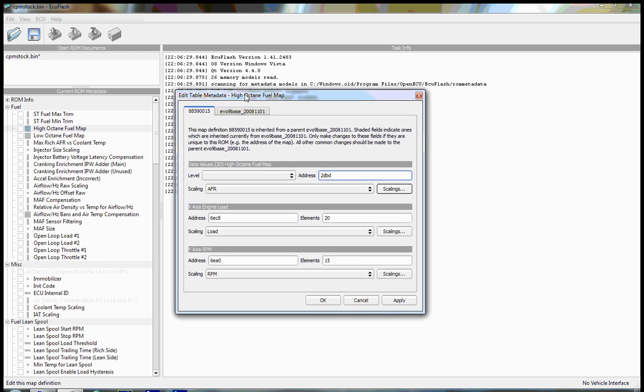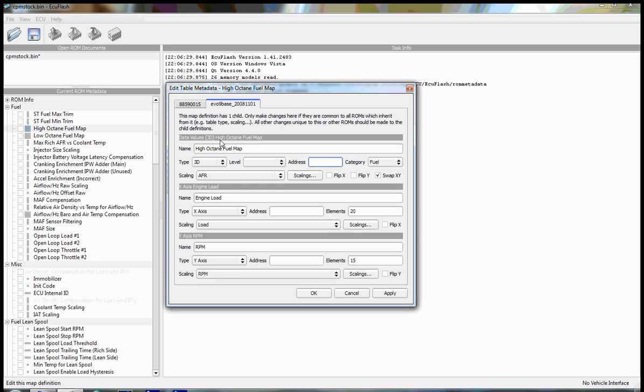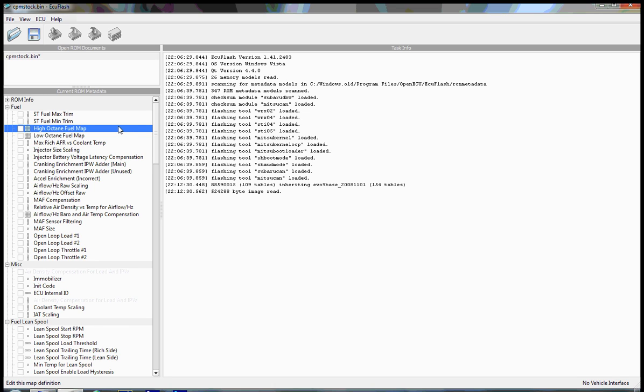So if we had a different Evo 9 ROM image that was not 88590015, we would still get this Evo 9 base parent, but we would get a different XML file that provides a different address for where the high-octane fuel map actually lives in that other version. So that'll help you understand exactly how things are structured in ecuflash. It's based on inheritance. It's based on XML files that can be edited directly, which we'll get to in the next video, or it can be edited graphically in the ecuflash application.